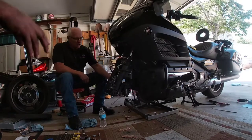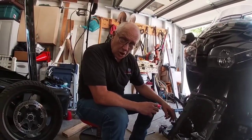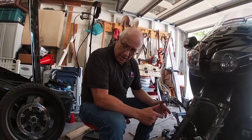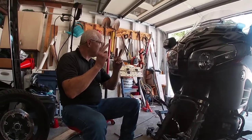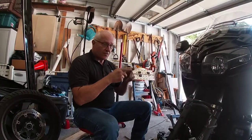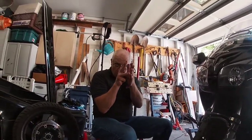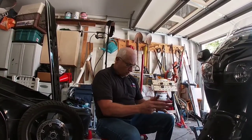What I did was I attached this back on here. What I'm going to do is spread these pads. Because obviously the new ones we're putting on are going to be wider. So when you put your wheel back on, you obviously have to have them wider, because you've got to slide your discs in there. They're not going to go in here where these are compressed. Your pistons are pushed in from the wear of the brake.